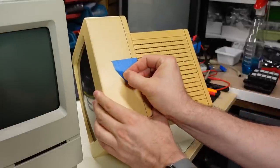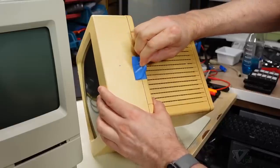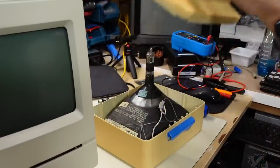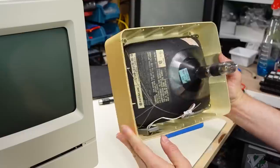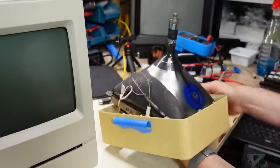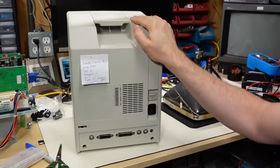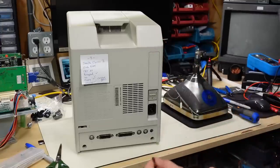I'm going to pop this apart — the monitor is entirely held together with tape, because without the chassis inside the case there's nothing to screw it together. With the tape removed, the top just lifts right off, and there is the really nice, good and strong Hitachi CRT that originally came in this Apple IIc monitor. With the screws removed, I can take the bezel off and free the CRT from its plastic enclosure. Next step is to disassemble this Macintosh Classic, which I call the Stealth Classic II, because there's actually a Classic II motherboard inside, even though outwardly it looks like a regular Mac Classic.